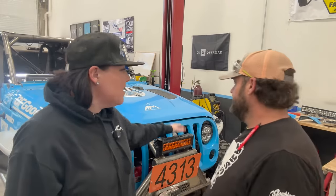Well, this thing, she moves and grooves, but she doesn't brake very well at the moment. So we're going to be putting in a new brake system. Yep, a hydro boost system from Wide Open Designs. So we need to pull the manual master cylinders out, cut open the firewall, remount the master cylinder and hydro boost plate. Yep. And design all that and get it to fit in the car and plumb it back up. And then it'll be done.